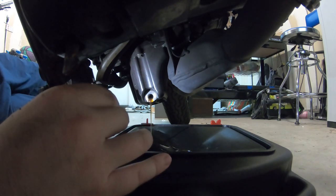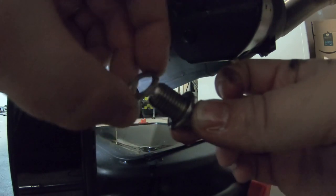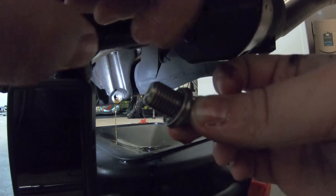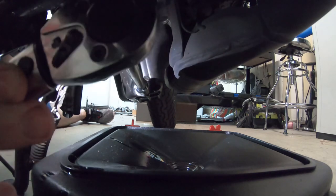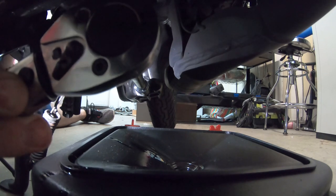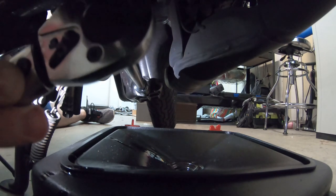Let it sit for 20 to 30 minutes, come out and check it, and if it's down to just an occasional drip you can go ahead and replace your drain bolt. The aluminum washer on here — you can reuse these at least once. What I like to do is take it off and flip it around so that the crush point is now fresh, using the fresh side as our crush point to seal against the drain pan. Our oil came to a slow drip, so I've gone ahead and reinserted the drain bolt finger tight for now. Then we're going to use a torque wrench to snug it up — the torque setting is 22 foot pounds according to the manual. If you don't have a torque wrench, just get it nice and snug and do about an eighth to a quarter turn extra. You can feel when the crush washer seats. Don't go any harder — it's an aluminum drain plug and an aluminum pan, so you do not want to strip it.